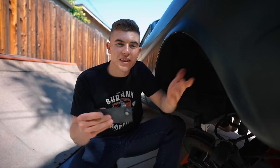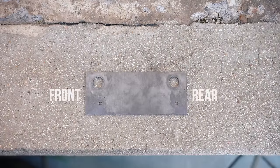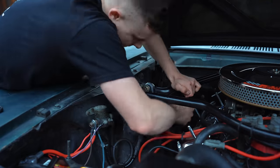It's the next day — no more rain, thank god. Now that the upper control arm is out, we can bolt in the template using the pre-existing holes the upper control arm was using. In my specific kit, it says to use a half-inch bolt to secure the template. An important thing to mention is that you're going to want the pilot holes towards the rear of the car.